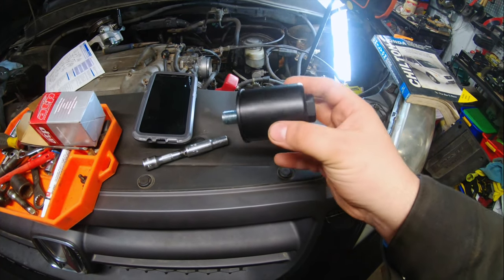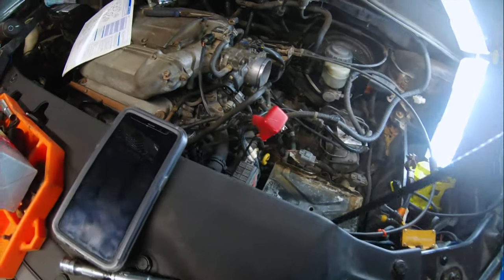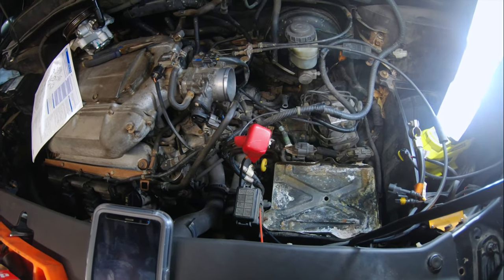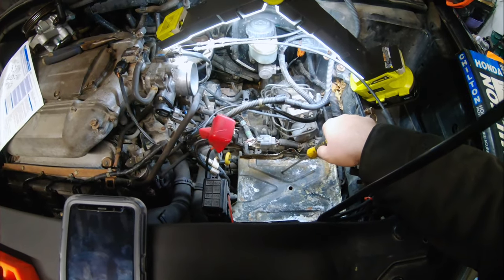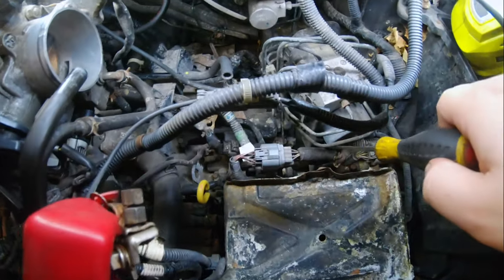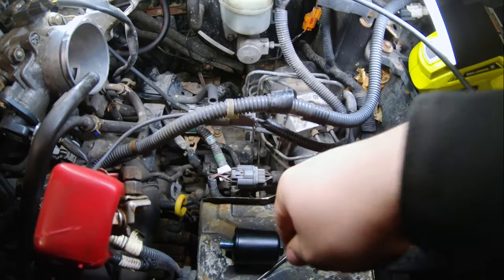Take a mental picture of this because you'll need it to figure out where it is. I'll grab a screwdriver here and attempt to point it out. You'll need to remove your battery and your breather tube, then follow me into the engine bay. You will most likely need to remove the battery tray to get to it. This tube-shaped thing I'm pointing to right here — this is your filter.